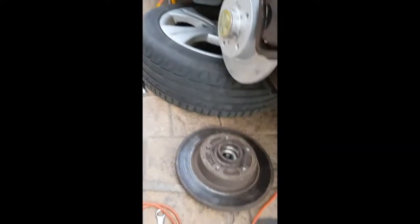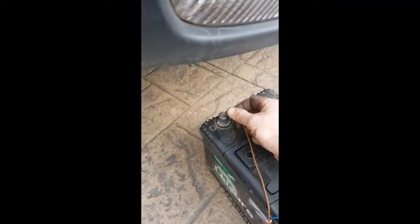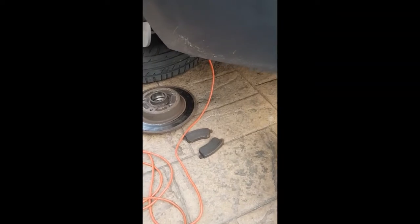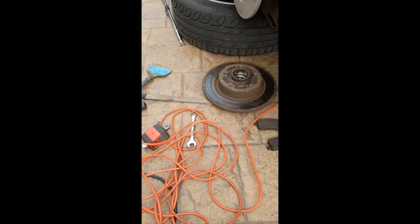Brakes on. Check — it shouldn't move. No, it doesn't. Good. Now the last bit — we need to trick the brain of the computer to think everything's just like it was when it went to sleep. So we're going to back it off just the same amount that it normally does when you take the brake off. Ready, steady — that's about the same. And that means when it locks them back on again it'll think everything's great. When you put the car back to wake it'll think the brakes are off just like it left them.